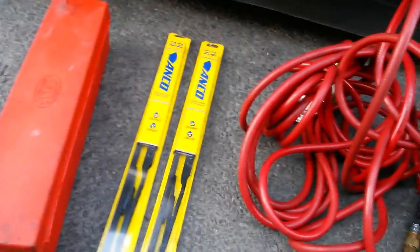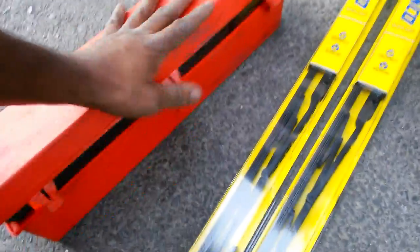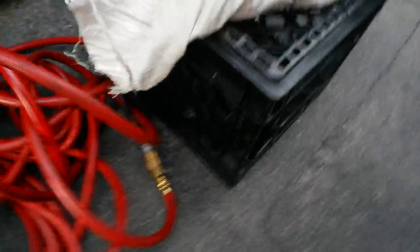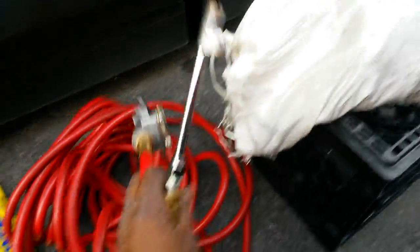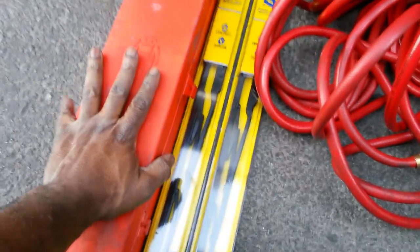Have you an extra pair of windshield wipers just in case your current windshield wipers go bad on you. Also, make sure you got your reflective triangles and they're in good condition. So to recap: four bags of chains, your tire inflation airline, extra windshield wipers in case the rubber's worn down, and your three reflective triangles.